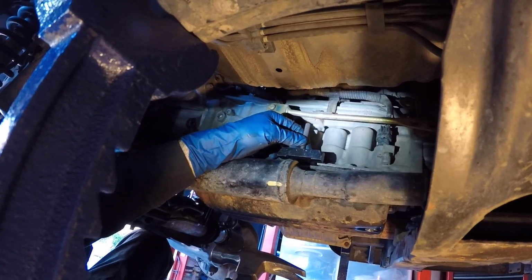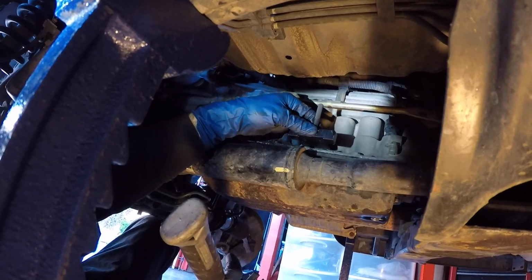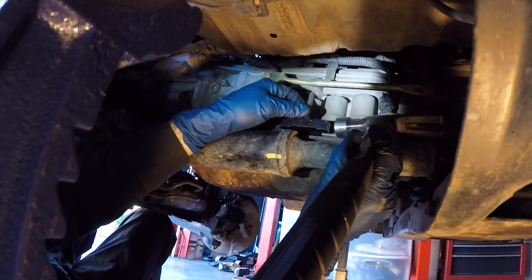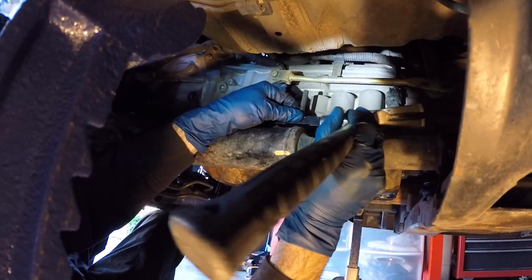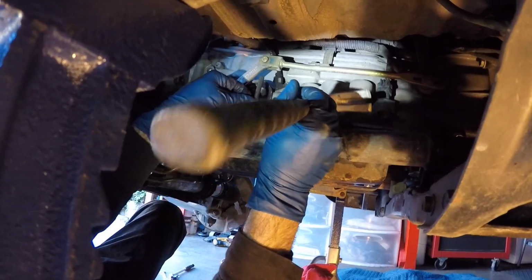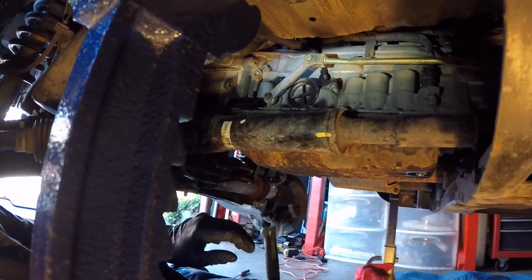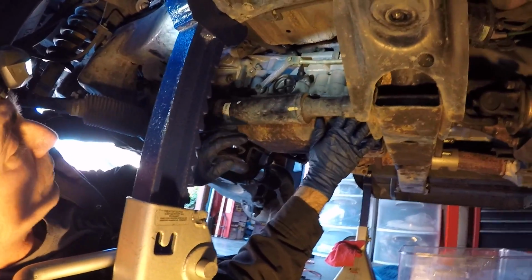So once you have the tool driven in pretty far, basically maybe like a ½ an inch, then you could hit it forward or backwards, and you have the striking surfaces on the side. So I just tap it. Right now I'm tapping it towards the engine, and I'm breaking the bond as I go. You just keep on tapping all the way down that side. So now I pretty much have the bond of the sealant broken free on this driver's side.